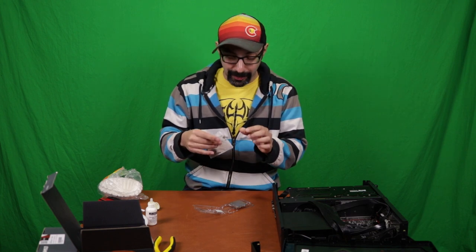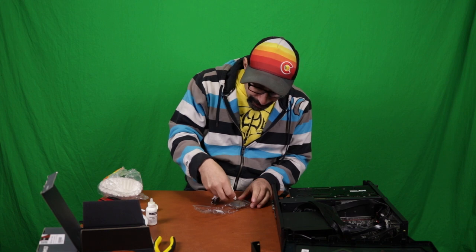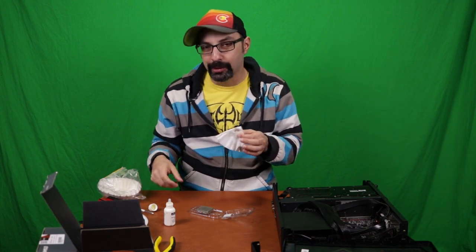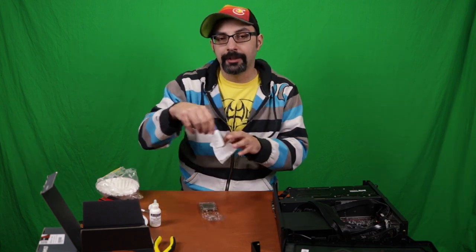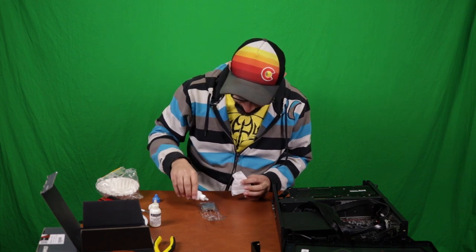Removing thermal paste is probably my least favorite thing about building PCs. For those benchmarking CPUs constantly and reapplying thermal paste over and over — I do not envy you. One thing to mention: thermal paste leaking on the sides of the CPU is fairly normal — I've seen it with a lot of CPU reviewers. You don't want it leaking onto the die itself, but a little over the edge is not a big deal. Just get the main surface clean. Now add the surface purifier and we can move on to installing the 1700x.